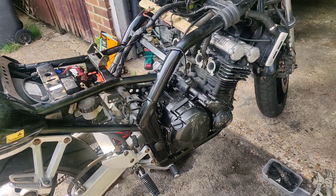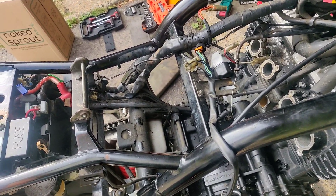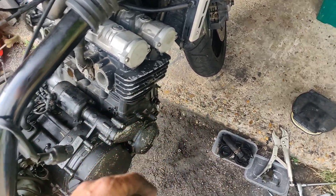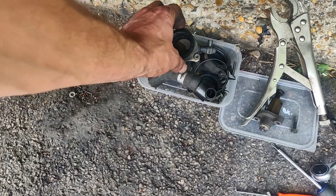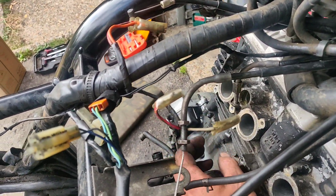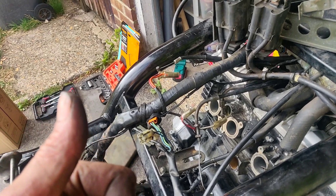Progress! What I had to do in the end was buy myself a bit more space at the top end — I just wedged it gently with a bit of wood, that's all it took. Right, best side of dinner time for me. I'm going to put the side cover back on, be careful not to lose things, put the cam chain tightener back on as well. I'll leave the boots off — they're coming through on the outside but fine on the inside, I will get new ones though, it's only about 20 quid. I'll cover the intake with a plastic bag to keep the shite out.